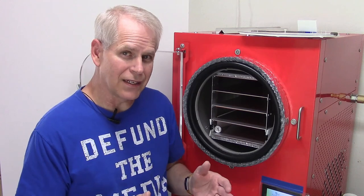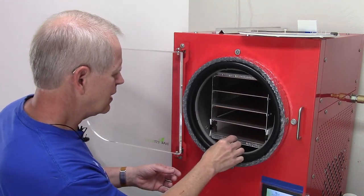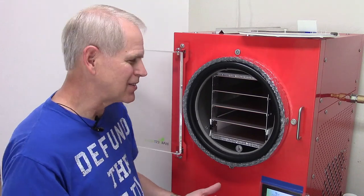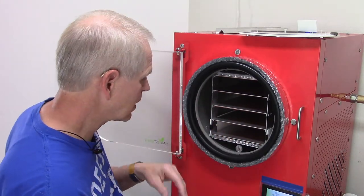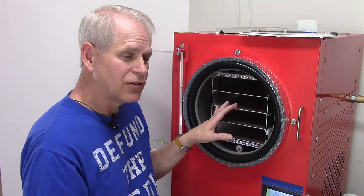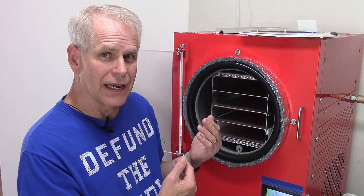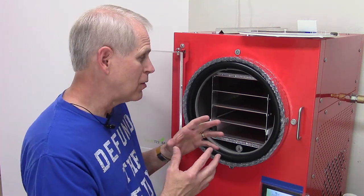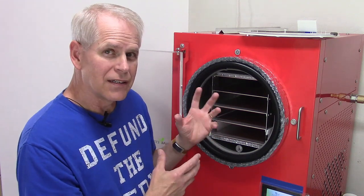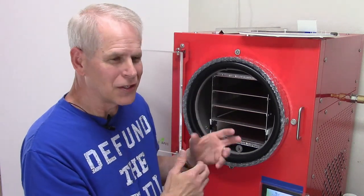We'll get this set and get it cooling and go get stuff to put in there and get the thermometer underneath. I don't really need to use the little grabber thing and wipe anything out because it's been probably 18 hours since it was running, so the fan's been blowing on it all that time. I highly recommend that if you use the defrost function, unless you've got another batch ready to go immediately afterwards, open the door, put a fan in the door, and really dry it out. It will help dry out all the components — the air pushing through will even dry out the drain tube area. Otherwise you're going to end up with moist, warm space in there that's going to be conducive to growing things you probably don't want growing in your freeze dryer.